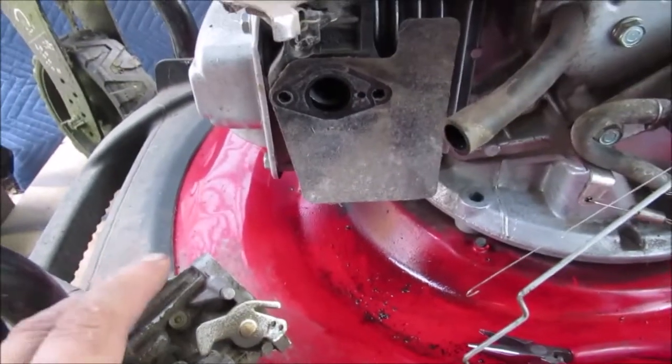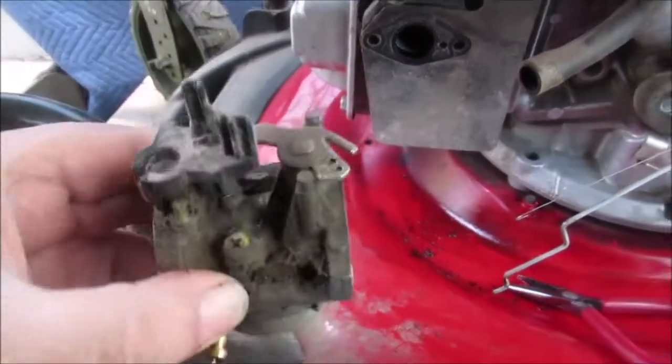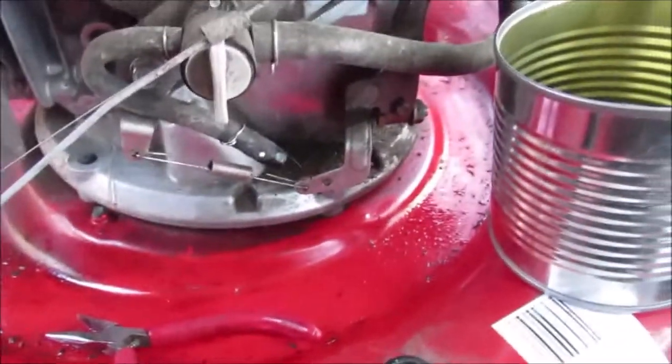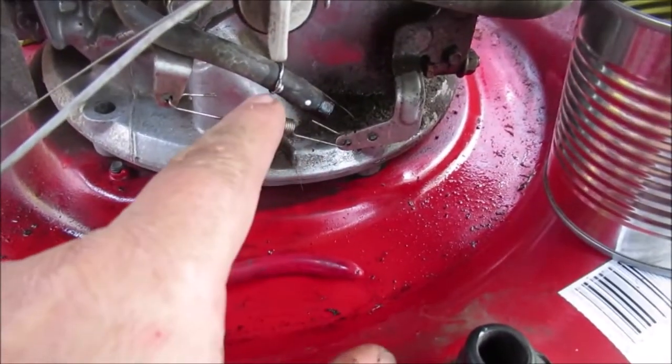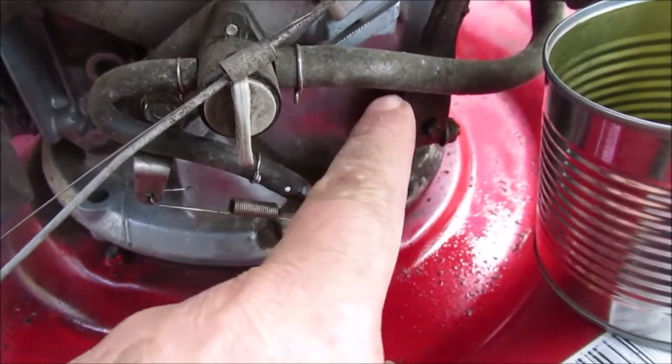And there's the carb. We're going to call this part one and keep these little clips short. See your little hose clamps — they're made of wire. Take like a scratch awl or little needle nose; I use my fingernail. Just pry them apart carefully, these little clamps, and slide them back on the hose.